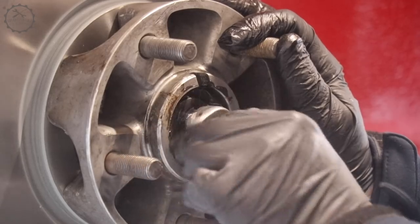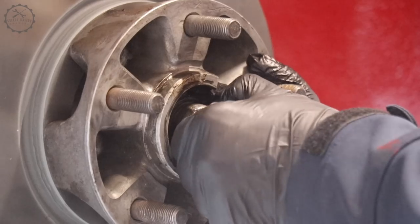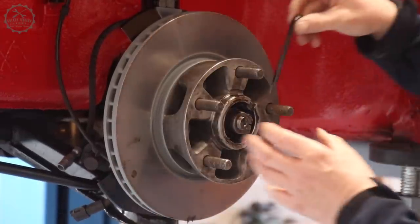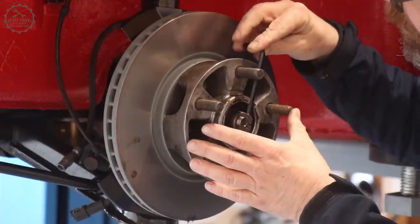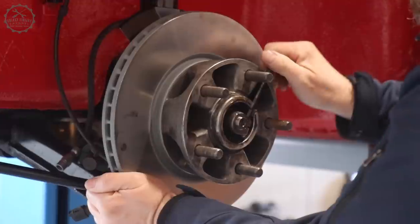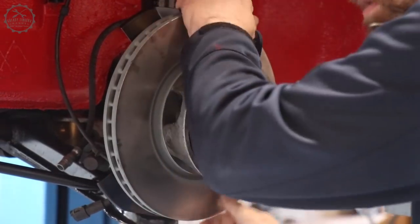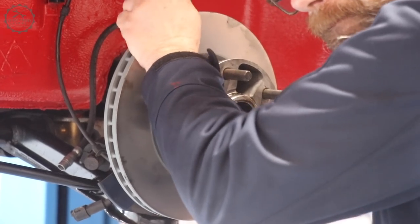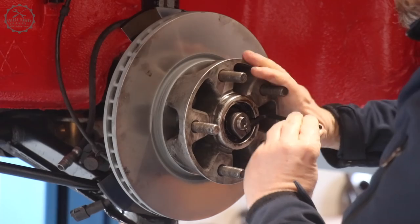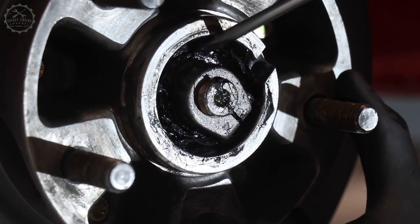Adjusting this wheel bearing means turning the clamp till no more play appears. The tricky thing is sensing if there is any play. Play in the wheel bearing can only be detected in vertical direction. In horizontal direction, one only feels the play in the countless parts of the steering. I also made the experience that using the discs to wiggle offers too little leverage to find out what is really going on. I suppose that's why some sources on the internet say that if this little disc can still be moved around, just a hint, the tension is okay.